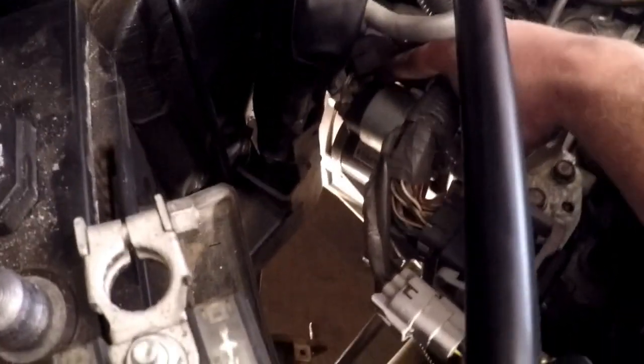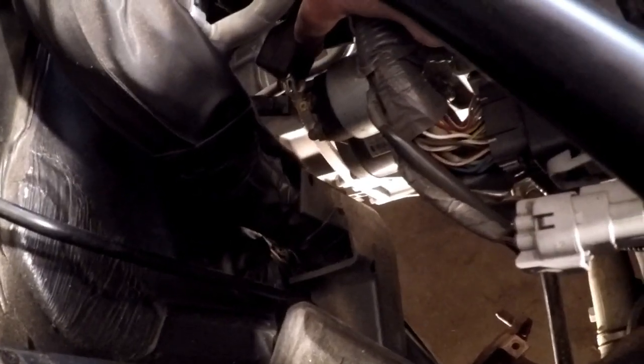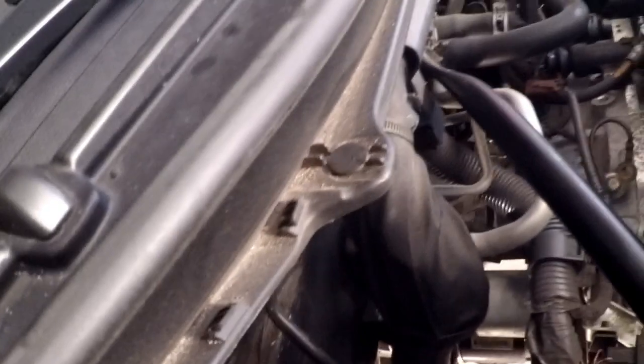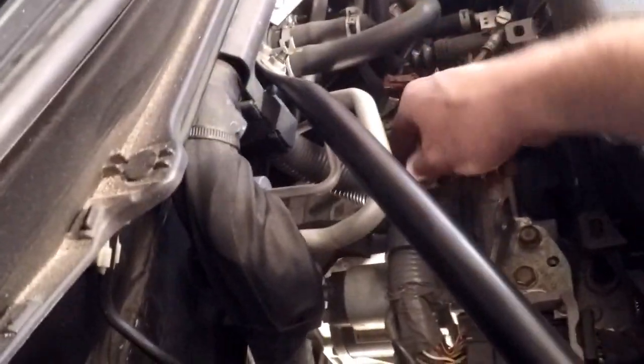Now that all the wires are disconnected, the pivot actuator, I guess, is off, and the wires on the starter here, so you can see, one of them was a little connector, had a lot of grease on it. The other one was a 12mm nut on the back. It's loose. Now, every one of the bolts can be accessed on the bell housing underneath the car. The only one that you can't see, got a feel for, is the top one on the starter here.